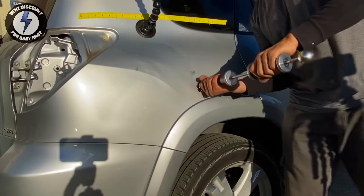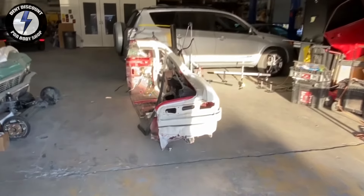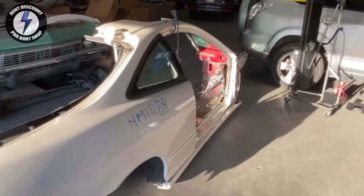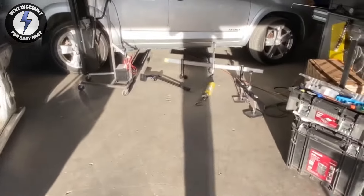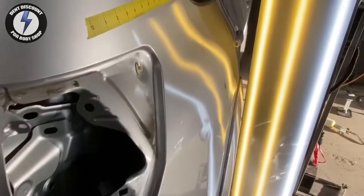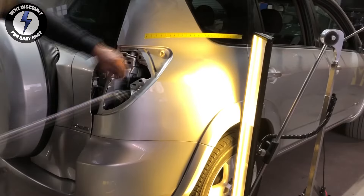This car is ripped in half — we're going to use that quarter panel to replace another quarter panel on another vehicle. Here is the RAV4 parked in the garage under different lighting, so you can see the remaining lows and highs. I will need to bring up those lows with my PDR rods. There's a great push angle at the tail light. I am now scraping the back side of the quarter panel, removing the sound deadener, going after the remaining lows of this huge 26-inch dent.